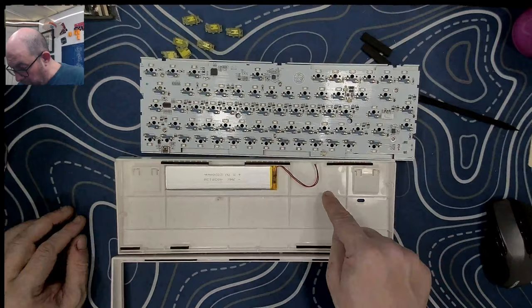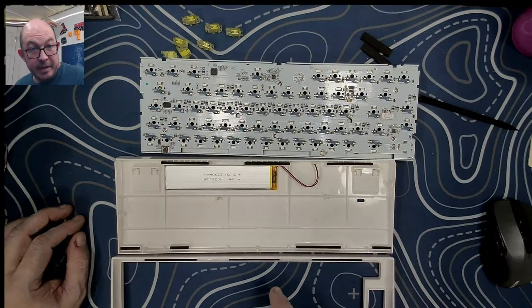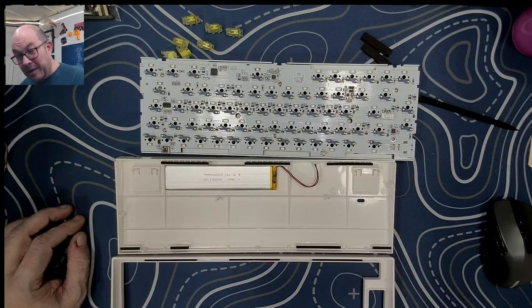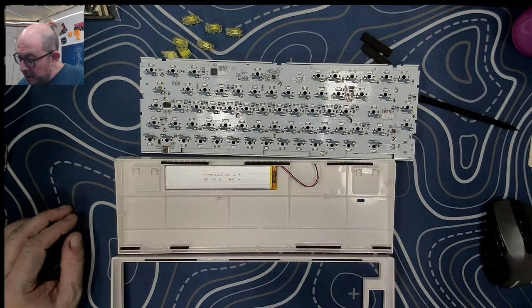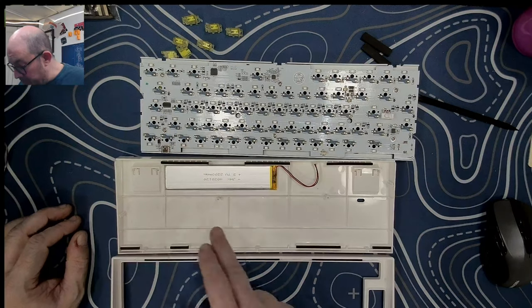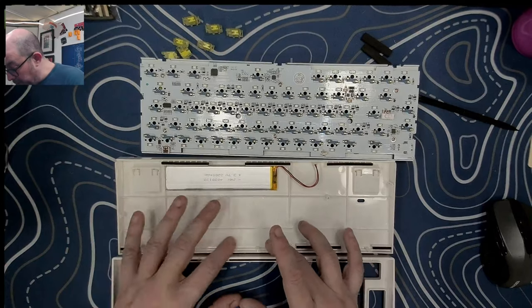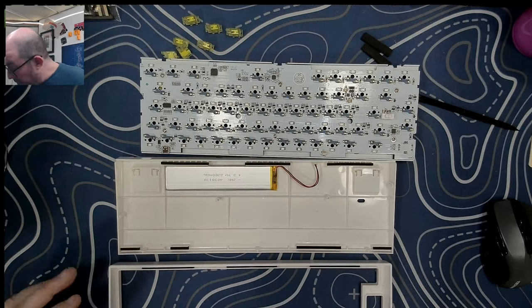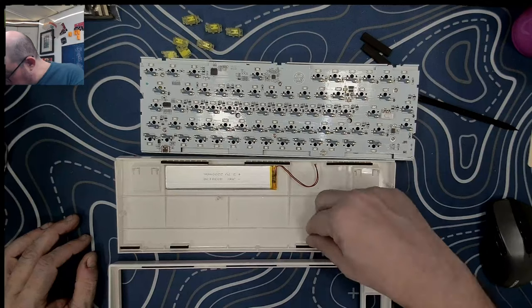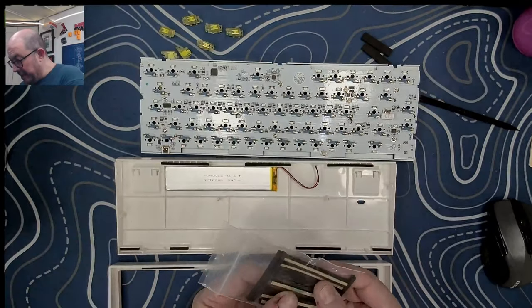Now, if it wasn't for the studs and the ribs, I would probably just go ahead and cut out a kill mat, the mass loaded vinyl, to put in here, but I have another kit that I think it's going to work in. So whenever I come across a situation like this where we have a lot of ribs, I have found that silicone usually works pretty good, especially if you stay underneath the ribs. I'm also going to try to cut out a couple more gaskets.